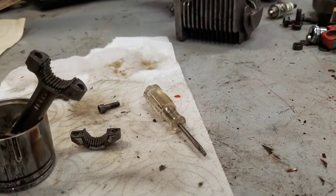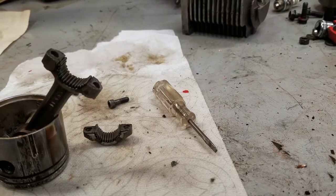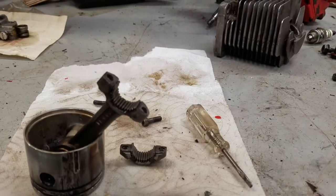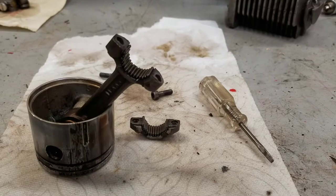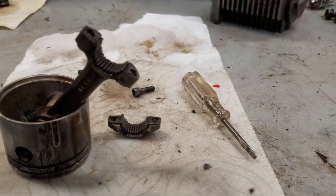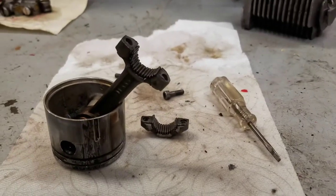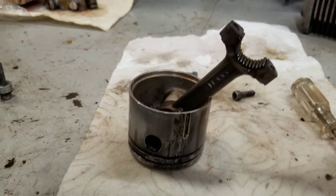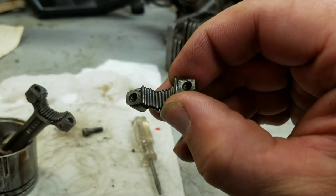These things are hard to hold into place obviously — 31 little bearings — you've got to do something to keep them there as you get them around the crankshaft. So take your good clean grease and put a light coating on both the rod and the cap. Just a thin film is usually enough to hold them into place, something that will keep them from slipping out when you turn it sideways or something like that.